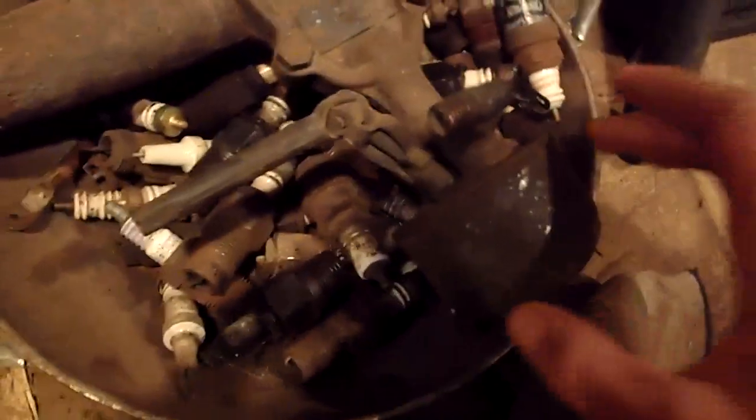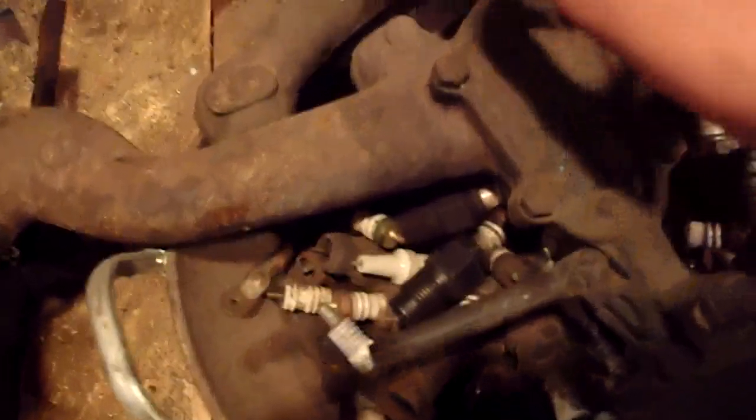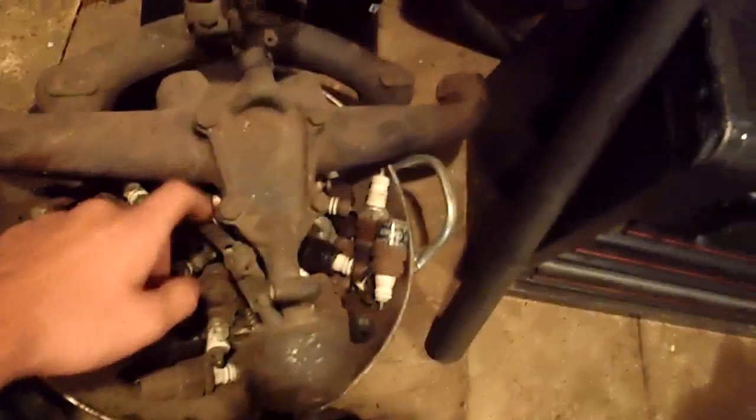I'm just looking for a carburetor for the engine, because it doesn't really have one right now. I've got a bunch of guys looking for them. I've got this Holley vaporizer carburetor, which was introduced in 1926 as an option because the gas was so bad back then. These things could actually burn kerosene when the engine's warmed up, but they're very temperamental to get running. It basically vaporizes the fuel. You've got your exhaust manifold here; the fuel gets sucked up, there's your air inlet, and it goes over this plate which is heated by the exhaust manifold and vaporizes the fuel. The air gets up there, it's all mixed up there, and goes into the engine manifold. But these plates separating the intake and the exhaust - if they have any holes in them, the engine won't run right.